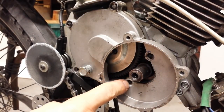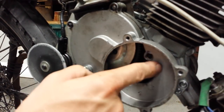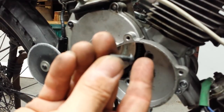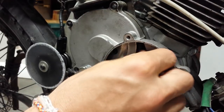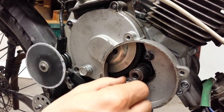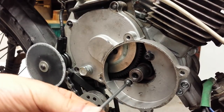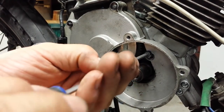I swap out the normal bolts used at these two mounting points for the extension housing with button-head cap screws — M6 by 15mm long. I find it's much easier to use this method to get good purchase on these screws. If you use the normal Phillips-head type screws, they tend to strip out; it's just hard to get good purchase.